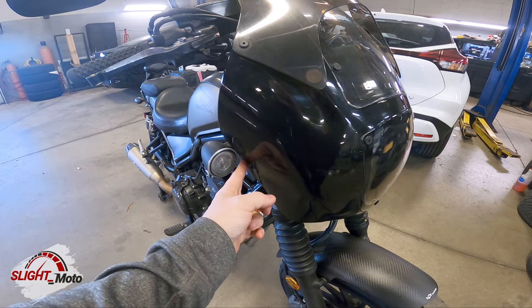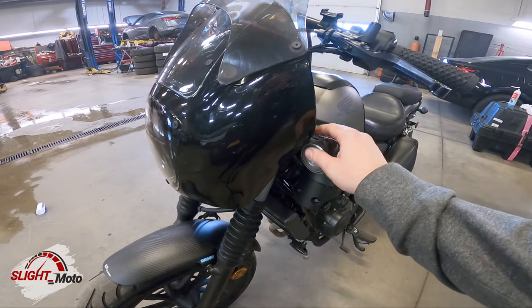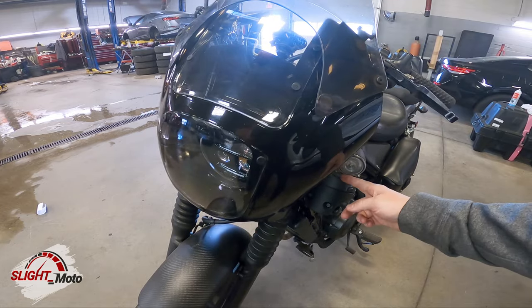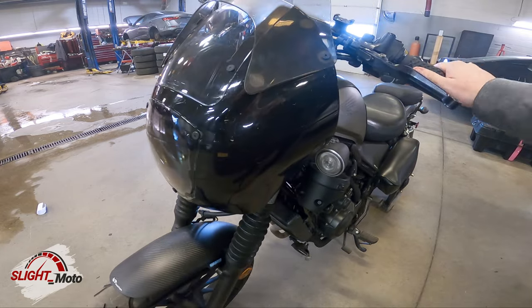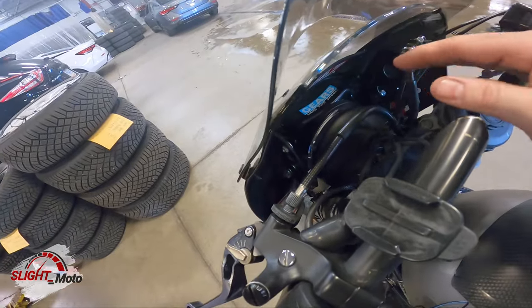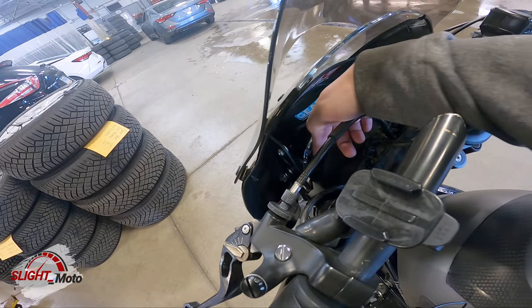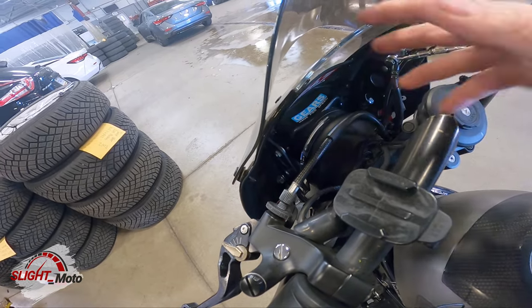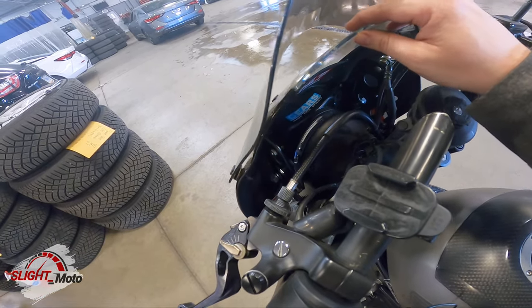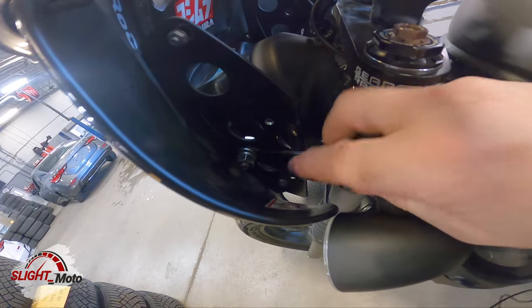As you can see this is going to be coming close, so we're going to bring these down just a little bit — only enough so there's no clearance problem. I've got about an inch here so that's okay. If you need to make small adjustments, just loosen the 10mm and that will slide a bit. Right now it'll move since it's not tight, but once I have it tight to the windshield it won't move. So we're going to tighten that up.